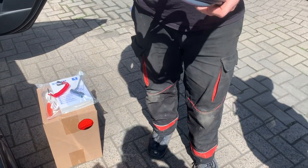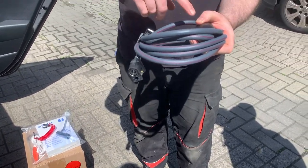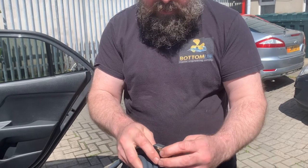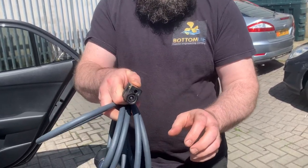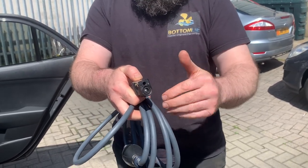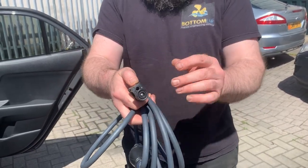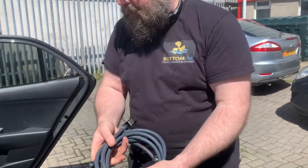When they're brand new, they sometimes take a little bit of doing to get the air out and the fuel in. What you do is plug it into your fuel tank with fuel in obviously, and then at the engine end, if you part-plug it onto the engine and pump the ball, it primes it up. Be really careful of that fuel that's knocking about — don't accidentally set fire to it somehow, maybe have a rag under it. You only need to do that once, just to prime it up the first time because it's brand new and has never had fuel in it.